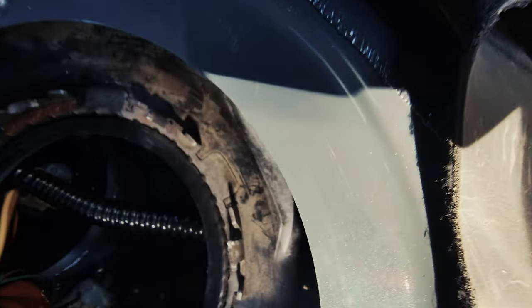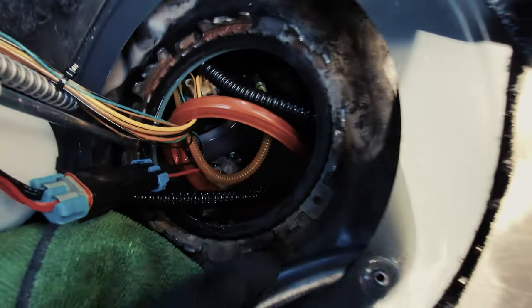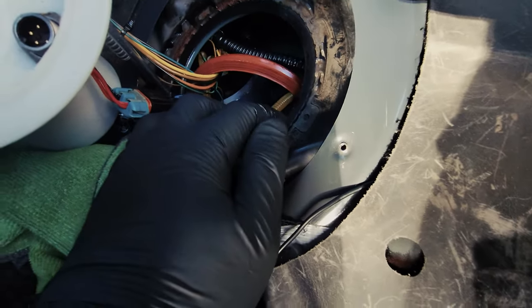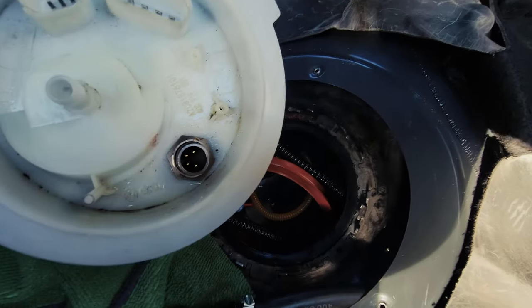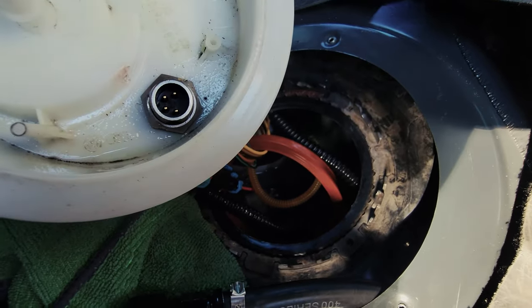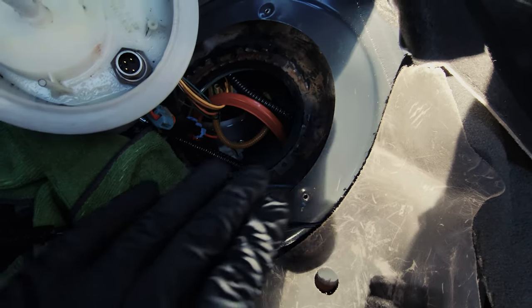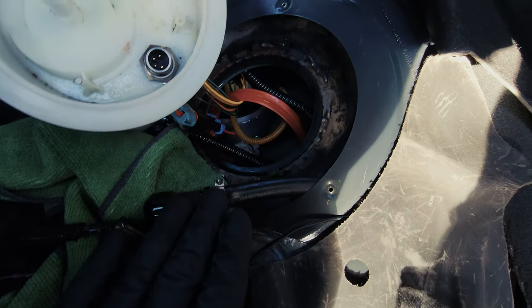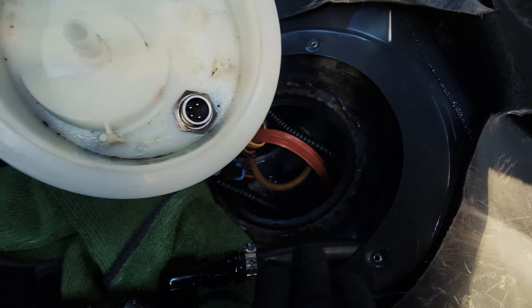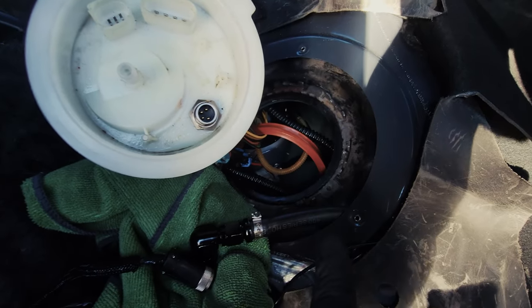The siphon — we believed at some point it was plugged up, because it creates a vacuum suction to pull fuel out of the tank into the bucket down there. We removed the siphon and blocked it off, thinking that would help fuel flow. But in retrospect, I don't think the siphon was the problem. I believe the tee connections were the problem — there were a bunch of fittings leaking. That's why I say no fittings: just hard-mount everything, all hoses directly. No fittings whatsoever, because they'll inevitably start leaking and give you fuel problems.